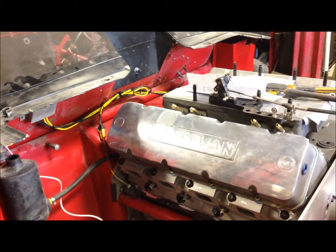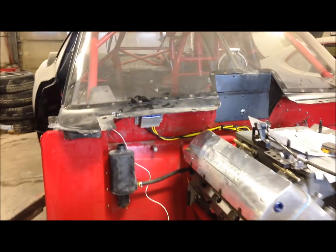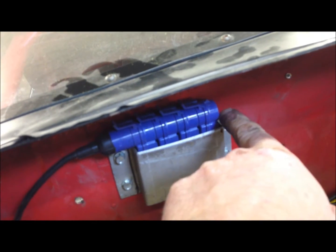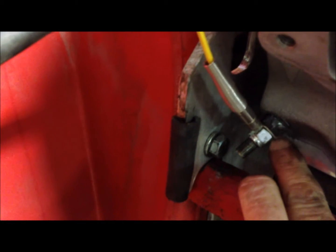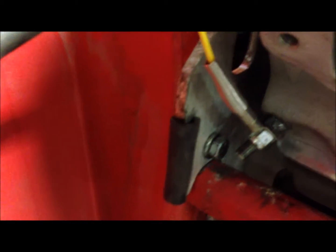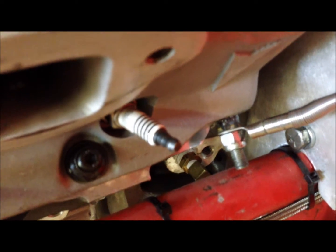While the battery was charging I installed the sensors for the data logger and made a little bracket to hold all the plug-ins together. This is the main cable coming from the logger and they just plug in together. There were some coolant plugs in the cylinder heads — I removed those, found a steel pipe plug, welded a bolt to it, and bolted the cylinder head temperature sensors to that. I've got them on both sides, so we should be able to get cylinder head temperature readings off of those.